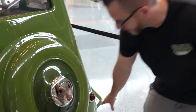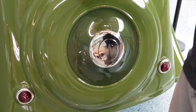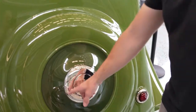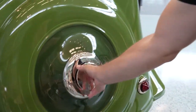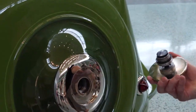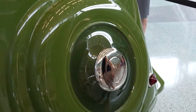We haven't done too much in the back of the car — we repaired a bunch of rust in the bottom and remade the tail section. One of the biggest things that Willys guys aren't too happy with is that we welded the spare tire well into the body. We also made a fake hubcap — we hammered out this trim ring and found another hubcap to use the W, and we've turned this into the gas fill. You just unscrew this, pull it out, put your gas nozzle in, and when you're done you screw it back in and pop it back so it looks like a hubcap.